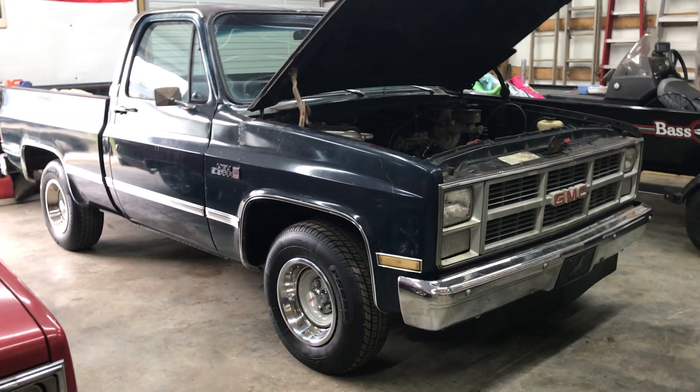I'm going to put in something like a 2,400–2,800 or 2,500–3,000 stall — probably go as small as I can just in case something happens with the motor. A 2,400–2,800 should work fine with that 305. I never had a problem with this motor like I'm having now when it had that flywheel and starter on it, so I'm putting it all back. Hopefully we're ready to go. All right guys, y'all have a good one — I'll catch you on the next one, hopefully sooner than later.